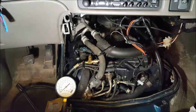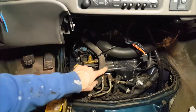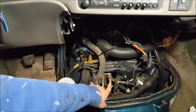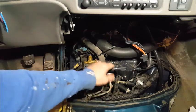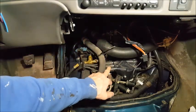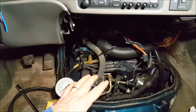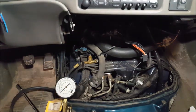The doghouse has been removed and I've put a fuel pressure gauge on. The line you see here behind this hose — there is a valve on this line right here, this silver line. That's the fuel line, and here's the return line for the fuel. When you turn the vehicle on, you get a burst of pump run for about two seconds, so as soon as you turn the switch on, you should see this thing jump up. As you can see, that needle does not move.